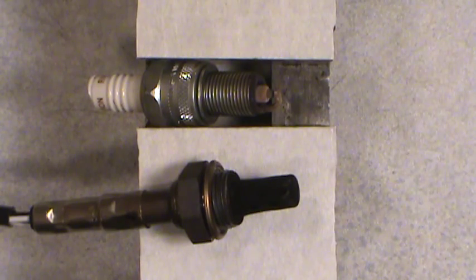So this is something to help you out. Any time you remove an oxygen sensor — some vehicles have anywhere from one up to four or more, pre- and post-cat — ask your mechanic or shop to give the old ones back to you after they service your vehicle. Or if you do it yourself, hang on to them and make a notation. Write down on a piece of paper the date, the vehicle it came out of, and note the deposits on it.